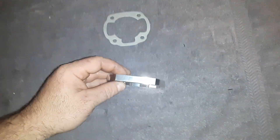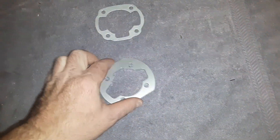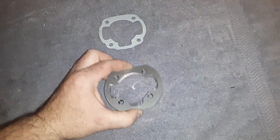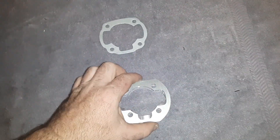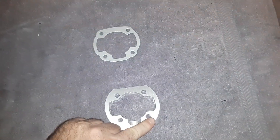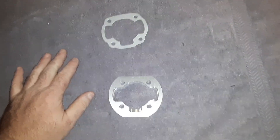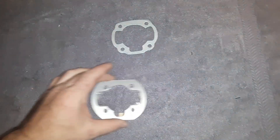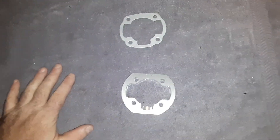It's pretty cool. If you get them a little thicker, about 10mm, you've got two options: you can either put gasket maker on one side, which usually goes right down on the block in between this and your bottom end, and then use the Minarelli head gasket — usually people tighten them down until you get the correct squish level. I use a Minarelli gasket and an 80cc gasket, which comes out to about 1.2mm, and I grind these off until they get to the correct height of what I want the squish to be inside the piston.